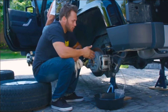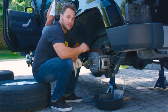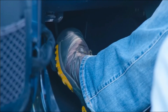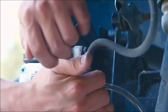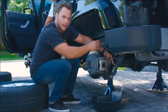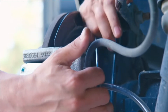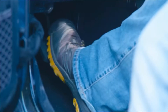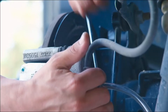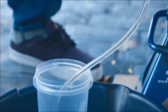With one person in the driver's seat and one at the wheel, when you're ready with your hose and wrench in place, say to the person in the driver's seat: 'Brake.' You then open the valve and you'll see dirty brake fluid come out. Care must be taken not to let air into the system — before the driver releases their foot off the brake, you have to shut the valve, then say 'Release.' Repeat this process until all the dirty fluid has been drained and you can only see clean fluid, making sure you don't run the reservoir dry and suck in air.